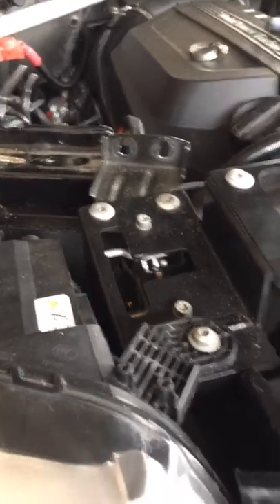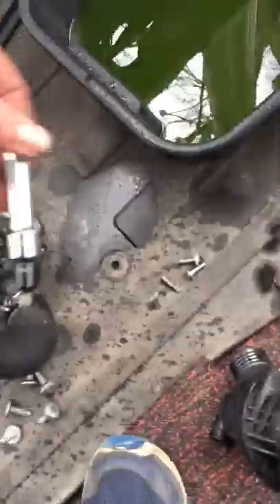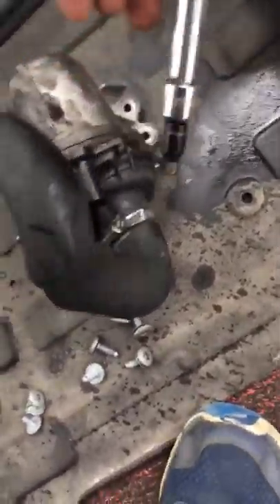I took the thermostat loose first so I could move it around, because like they say on the other videos, all the clamps are facing up, so it's kind of hard. When you put it back on you're gonna have to deal with the clamps facing the wrong way. It's a 6 millimeter that fits on this thing. When you're laying on your back or reaching up in the air, it's a six millimeter.